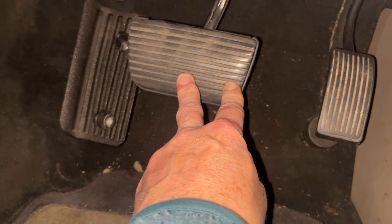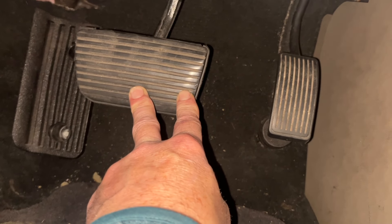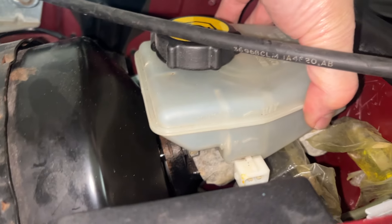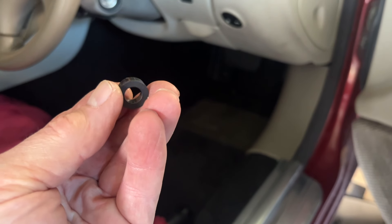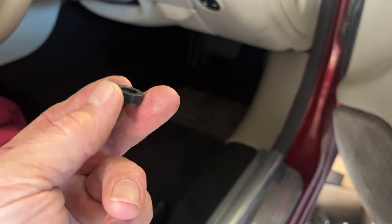Back to the pedal — I've loosened the pedal box off and I can actually move the pedal. This is not depressing the brake pedal; it's moving the whole system back. I think it's pretty much in line with the accelerator now. I'm going to stick some nuts under there and see what effect it has. I've used these little plastic washers — 8mm washers, 5mm thick — two of each underneath the servo and pedal box mounting points. Here's the result.